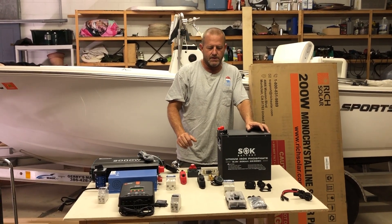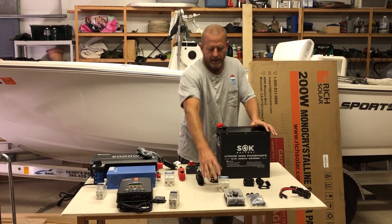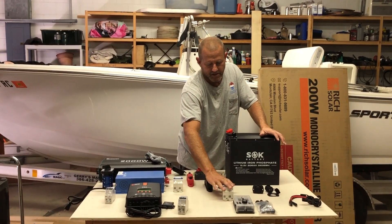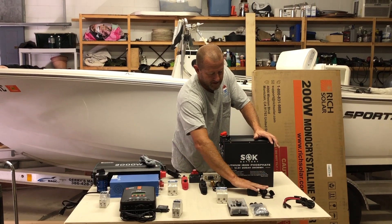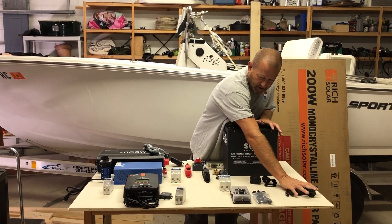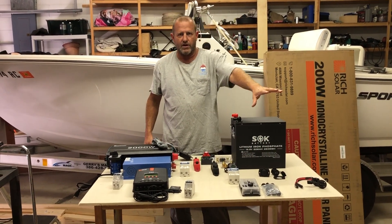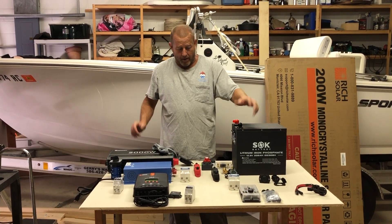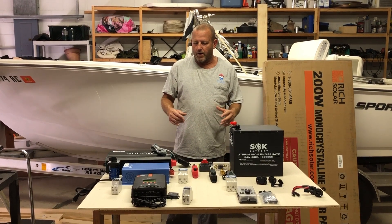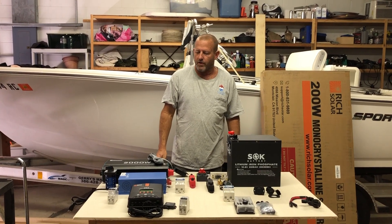That way I can isolate and service it. I also have my 12 volt circuit isolated with a 100 amp disconnect switch — this covers all of my 12 volt. I have USBs, switches, and accessory outlets, with plenty of spaces to add 12 volt. Whenever I can run 12 volt, that's my plan. Now we have to put all this together, wire it up right with the right size cables, and put it into the 2021 Runaway Camper.